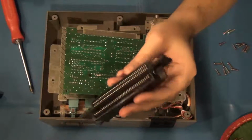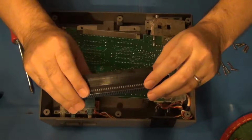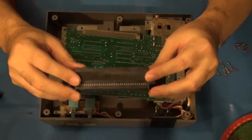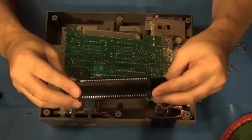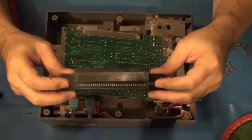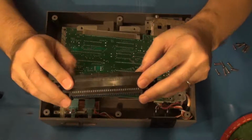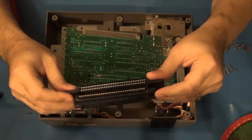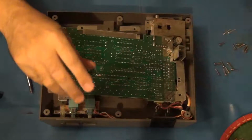This is why people used to blow on their Nintendo cartridges, because it used to magically make them work. Well, all they were doing was adding condensation to the pins, which temporarily improved the electrical conductivity of the game and allowed it to work through the pins. But that's also bad for a number of reasons. Condensation like that just causes faster oxidation and potential rust to the pins. So we're done with this guy. I'm getting him out of here.